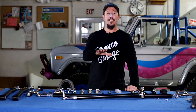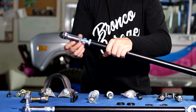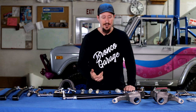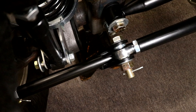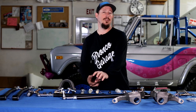Let's dive a little deeper into the details and specs of this system. What makes this Duff dual sport heim system so good? It starts with these three-quarter heim ends — very heavy duty and can handle quite a beating. You'll see them on every end of this heim steer system. From there you've got a saddle, which connects your drag link to the tie rod just like it would from the factory, giving you factory style steering geometry. Steering geometry is critical to prevent bump steer. Having the saddle there versus having the drag link attach all the way to the other side like other systems is definitely going to give you a better ride.